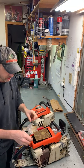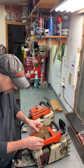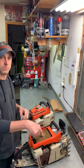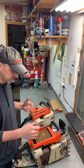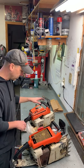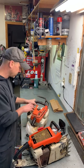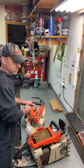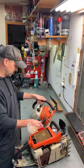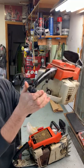then it's hard to find a Super. It's hard to find, period. Top end kits and everything are a dime a dozen for the regular one. You can go buy a new top end, new cylinder, piston, gaskets. The Super, I'll have to find somewhere. Hopefully this engine's good. It pulls over. They said it had 130 pounds of compression. Check it out. But I mean, it's clean.